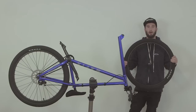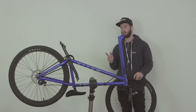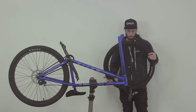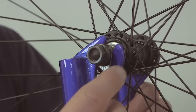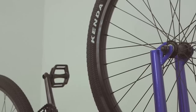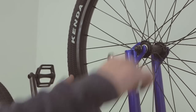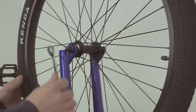The next thing we're doing is mounting the front wheel into the forks. I've turned the bike upside down as it makes it easier to insert the wheel. Just make sure when inserting the wheel that the washer retainers are placed on the forks. Once inserted, tighten both bolts on the front wheel using a 15mm spanner, one of which is provided with the bike.